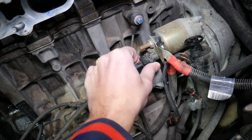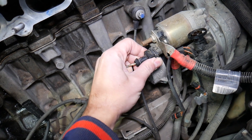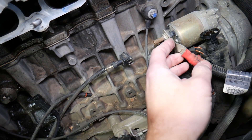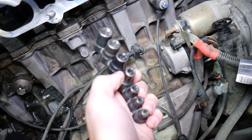We're in the process of replacing it right now. This is the ignition wire. In order to replace the starter, you need to press on the metal piece and pull that ignition wire out. You will also need to remove that nut — with a 13 millimeter socket — and once you remove the nut, those cables will come loose.